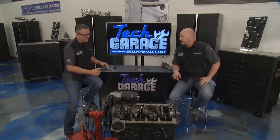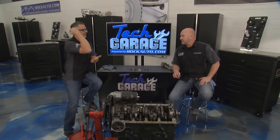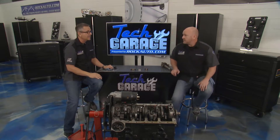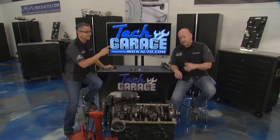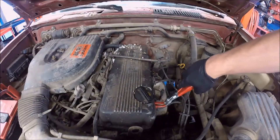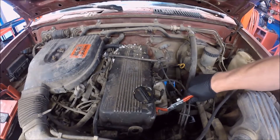Now, there's also rod bearings. This is great because the rod bearings actually come down with the fire. When it comes down with the fire, it's hitting that crankshaft. So if we take the fire away, it's going to lessen that noise, and we've got a great video that illustrates that. He's going to go from number one — you're going to hear a little change — to number two. There's really a big change. That's going to tell us the difference. Kyle, watch close — this is something you can do in your driveway with the right tools. So here he goes, now he's going to number one. Listen up.